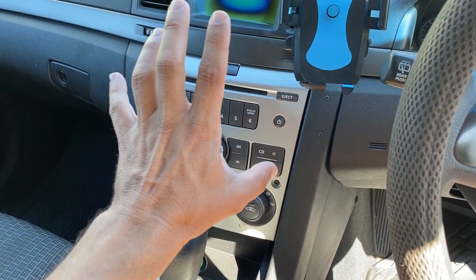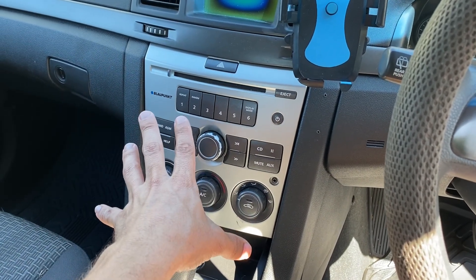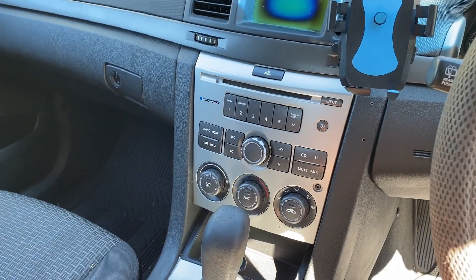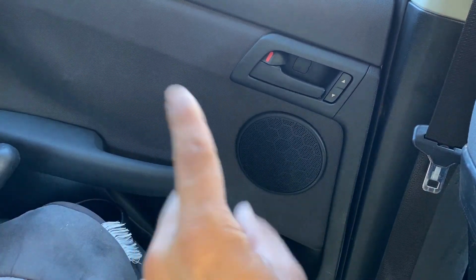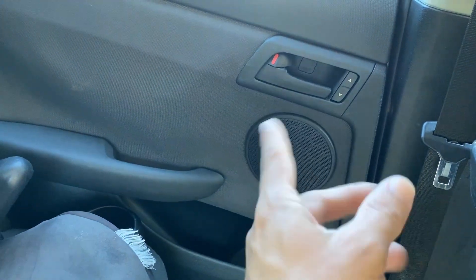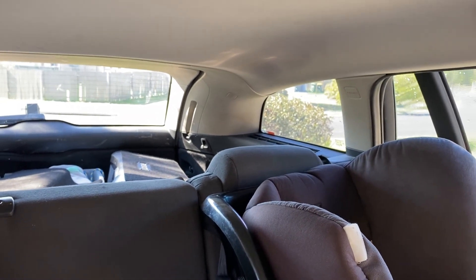Because of all this integrated section up front, I didn't want to play with the head unit. So instead of replacing it, I kept it and found another way to put some bass into the system. On the back there's another speaker, and I've used the positive and negative speaker wires, spliced out from that, running all the way to the back of the car.